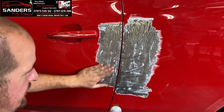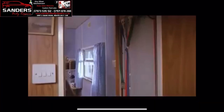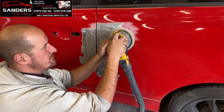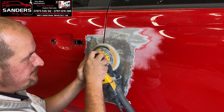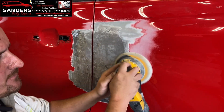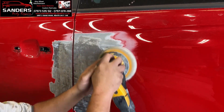While Matthew gets ready to put a skim of filler on, I'm going to make a quick cup of tea. That's a cracking job - good job. Matthew's buzzing over it quickly, keying up the area in readiness for the fiberglass to stick to. The reason we use fiberglass is because we're going onto bare metal - it just gives it a bit of a key to stick to.